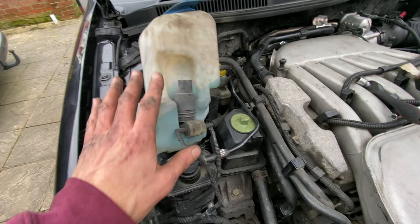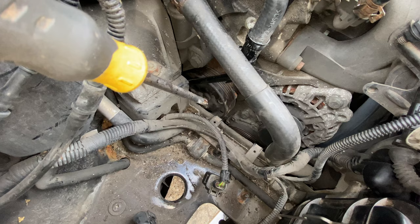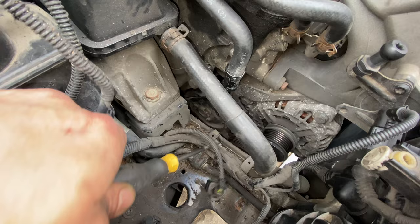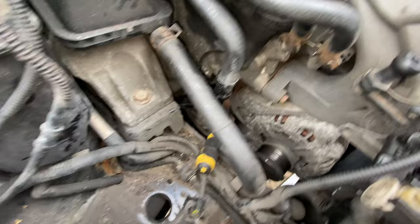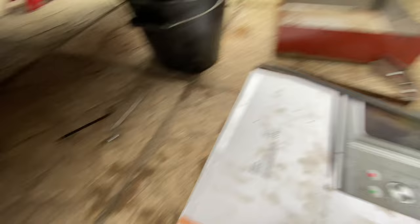Here's a little tip for anyone looking to do this job themselves. On the water pump itself there's a hole in the wheel. If you rotate the actual wheel there's a hole and you can put a screwdriver down there — what that will do is lock that wheel so you can go ahead and loosen those bolts without the whole thing rotating. It's all locked in now. It's the old six mil allen key and spanner trick.